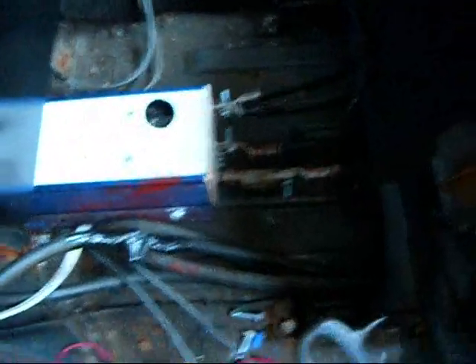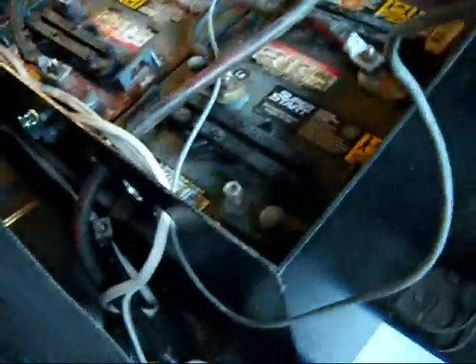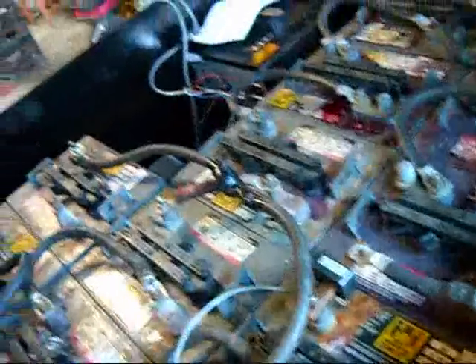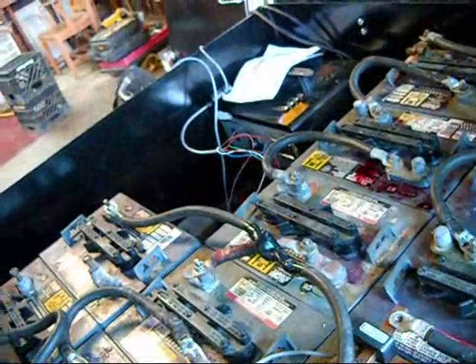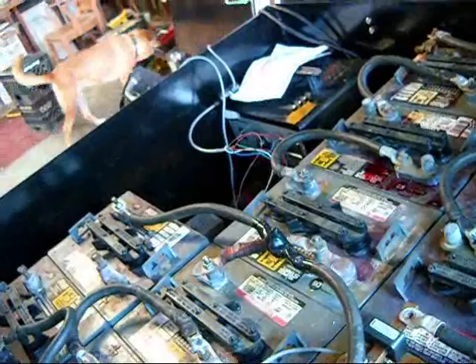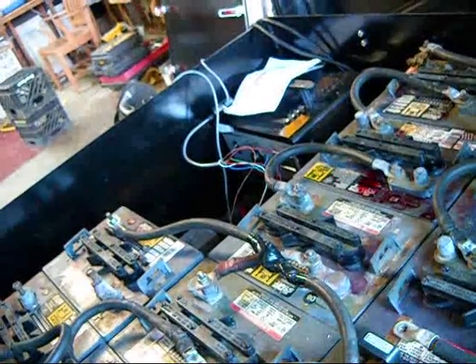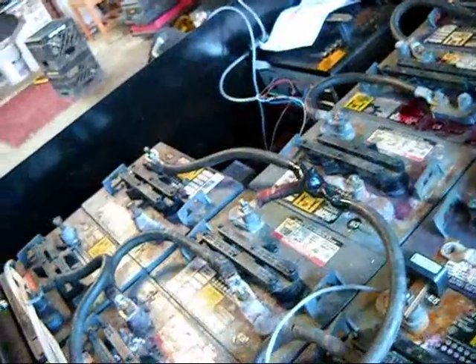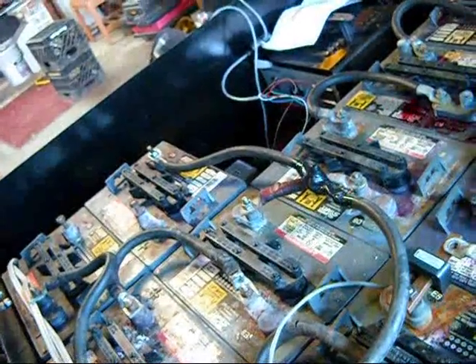The motor controller is hooked up for high voltage. Now I'm fixing to do the low voltage connections. This is our current sensor for the pack tracker — it's got to be plugged into the pack tracker. Over there you can see the little bunch of wires; that is the connection to each individual battery, and I'm going to be attempting to put all that back up.